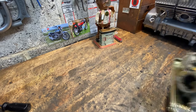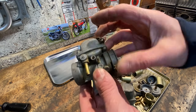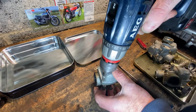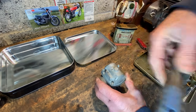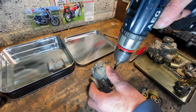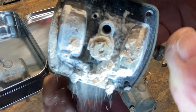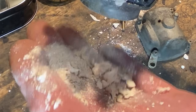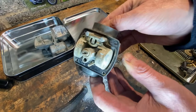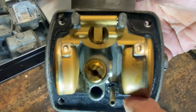With the ignition sorted, the next thing is the four carburettors. These carburettors are getting on for 45 years old and I don't know what state they'll be inside, so the first thing I do is remove the float bowls. The float bowl screws spin out freely, but the float bowls themselves were stuck hard and needed a fair bit of persuasion. The first one is remarkably nice inside — I was really pleased. The second carburettor was a totally different story — full of white powder, smelt horrible, but still looks salvageable underneath. The third had a coating of white deposits but nowhere near as bad, and I think it will clean up just perfect. And the last one was like brand new — I was totally shocked — it's like it had never been run.